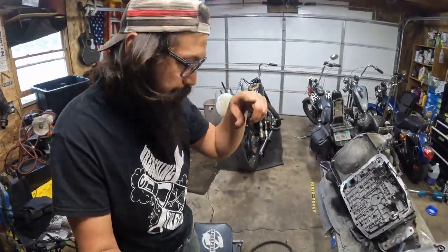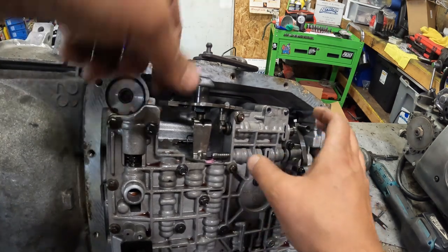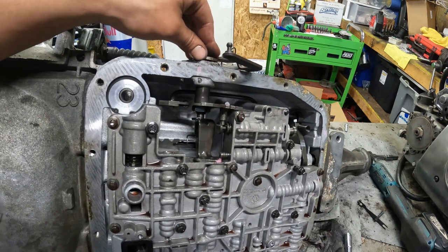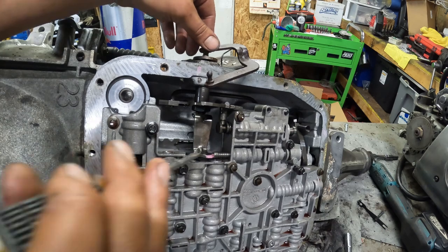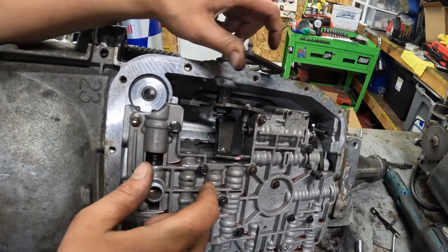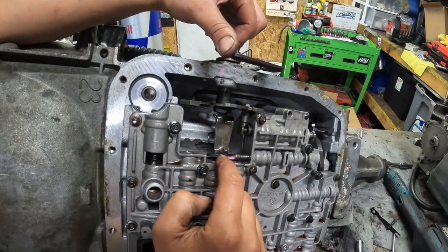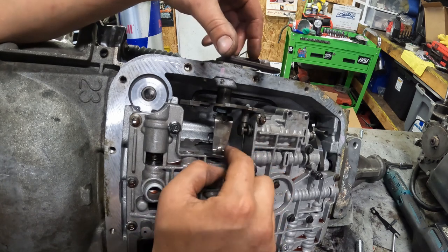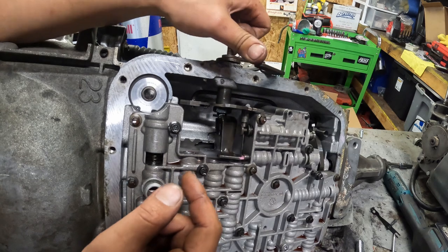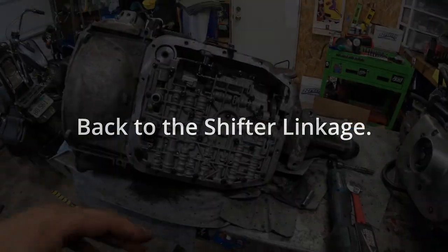When I was just showing you on the TV linkage — I forgot that when I pulled this outer nut out, this whole shaft assembly dropped down, which is where that was getting stuck. Now if I adjust this I can bring this back up. This is roughly the position that should be in when the upper nut is tightened down — it's going to hold that shaft through so as this goes back and forth it springs back. In the videos I was watching there's a little spacer and a bolt right here that goes through this, which I'm assuming will stop it from dropping too far in on the detent. Once the bolt's on that should be okay. I just need to make sure this is free and moving — it should go in and snap back, no drag, no issues.